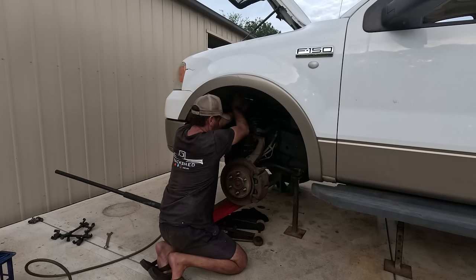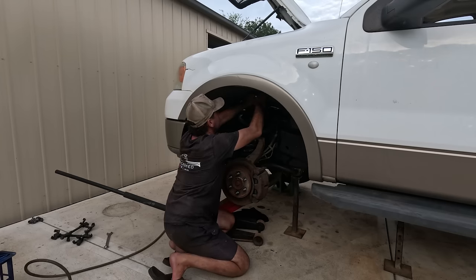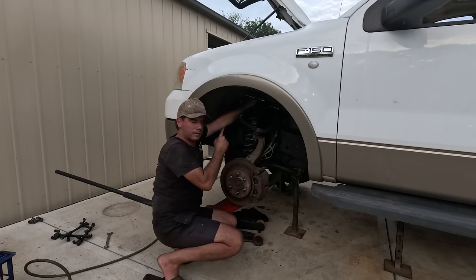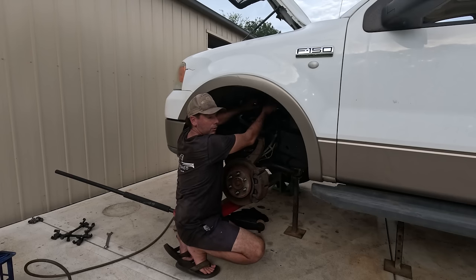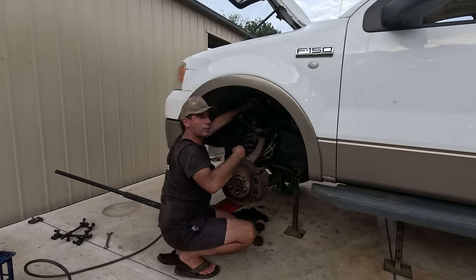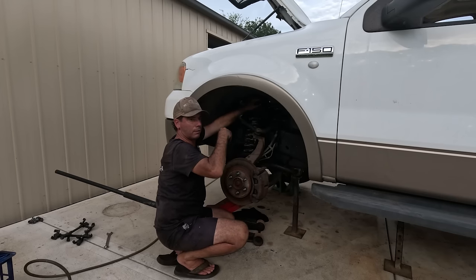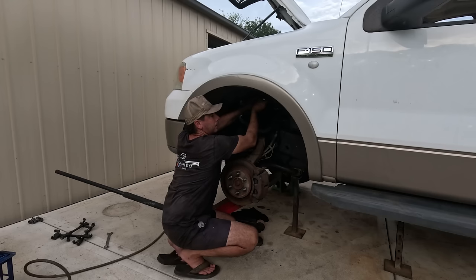I've got two more to do. We'll pop a wheel on. Then we'll go and settle them in, and then we'll actually see. Like I said, it's a 25 mil spacer. Doesn't mean you're going to get 25 mil. I actually think you're going to get a lot more. I'll have a guess and say 40. I did measure it before too. 185 tire to the guard, 135 at the front tire to the guard. So we'll see. We'll be able to tell exactly.